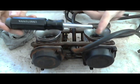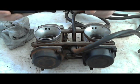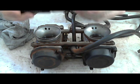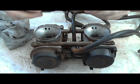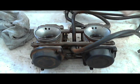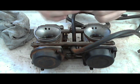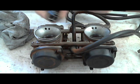I forget the actual name of the bit, but it's a Japanese style bit for the Phillips. This works fine. I've done probably more than 50 carburetors and I've never stripped out a screw. Even if it was already stripped out, I managed to get it off using this Craftsman T-handle screwdriver. It's both this and a T-handle, so you can snap it out, snap it in, so you can really push down.